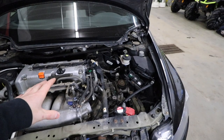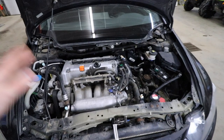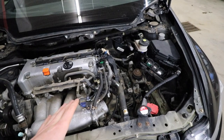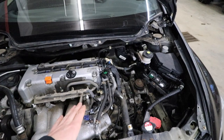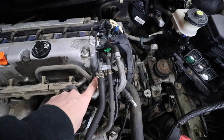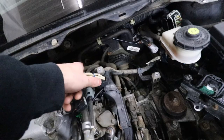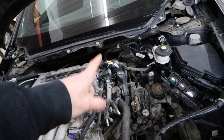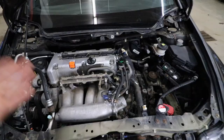I took off both covers. I'm going to put new spark plugs in for when we boost it, since I have no idea how many miles are on them. We now have access to the fuel rail. We are not building fuel lines or doing anything fancy — we're sticking to the stock returnless fuel system. On these 8th gen Civics, there's one feed line coming into the fuel rail and it's a dead-end rail. I'm pretty sure the regulator is actually in the tank on these cars — don't quote me on that. For now we're not pulling the fuel rail or spark plugs, just keeping the engine sealed up.